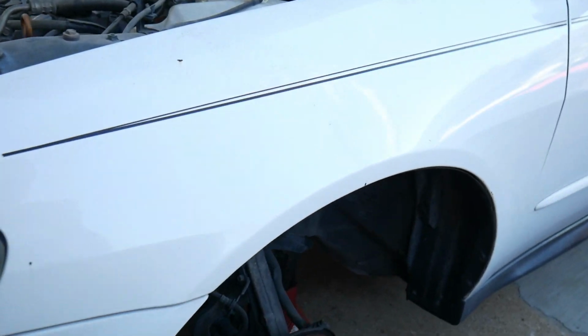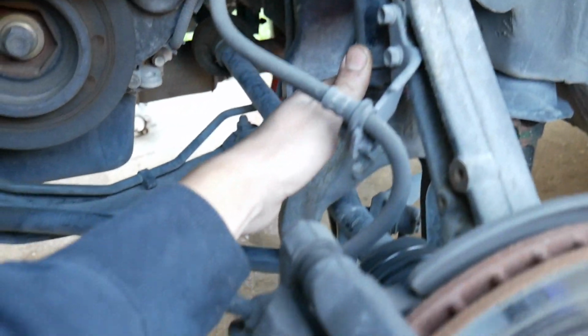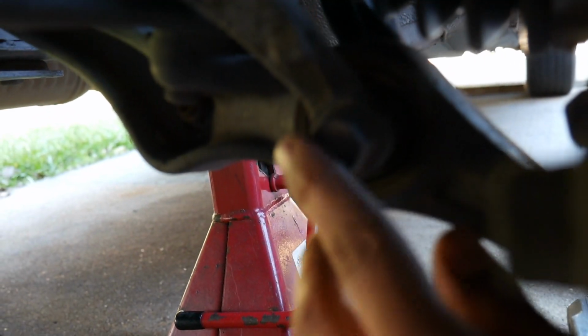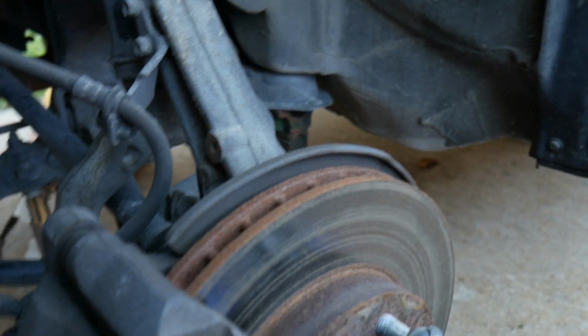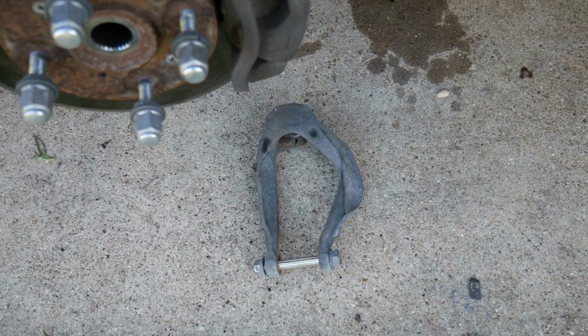So far, I took off the other side, the suspension, and took out the CV axle. Basically, loosen the bolt that goes here on the suspension fork, have the bolt and the nut loose right here on the bottom of the fork, and loosen up the lower ball joint. I know it's not zooming correctly, but I gotta get this side loosened up already. Alright, and this side has already been taken out.